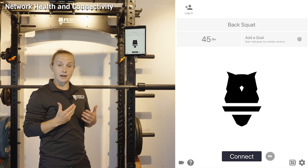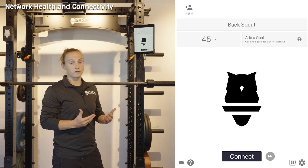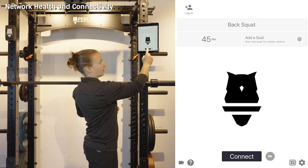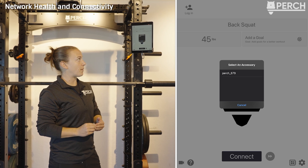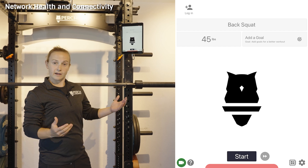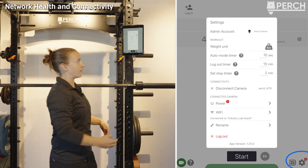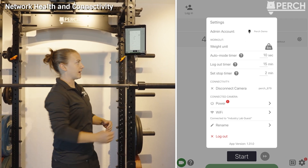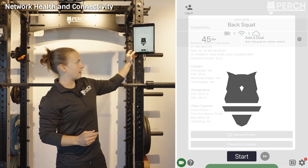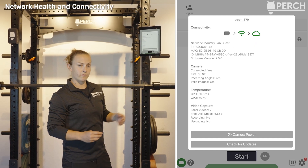To connect your camera: on an Android tablet it will automatically reconnect once configured in your tablet settings. On an iOS tablet you'll need to reconnect every time you reboot the camera — that's just an Apple setting. Hit connect, a select an accessory screen will pop up, your camera will appear, and you can select it to pair. You can confirm the camera is paired on the start screen or via the settings button on the bottom right. In the bottom left there's a camera icon — tap it to see that your camera is connected to Wi-Fi and all data is connected to the cloud.